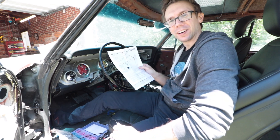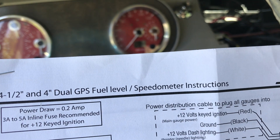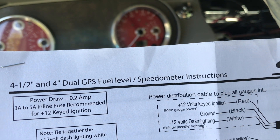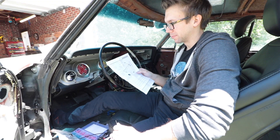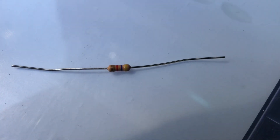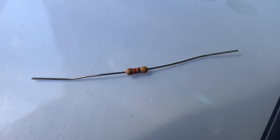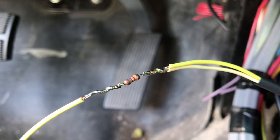To make matters even more fun, Speed Hut included a four-and-a-half-inch wiring guide for a GPS fuel level and speedometer — which I don't have. So I had to turn to the internet for answers. It comes out of the box with a 4.7k ohm resistor, but over the years I've found that some vehicles for whatever reason don't respond to the 4.7k and you need to go up to around six to ten thousand ohms. So just play around with it, because you're going to have to.